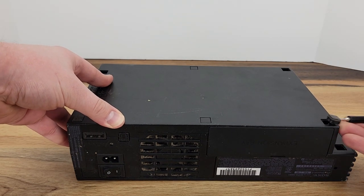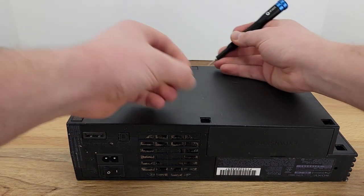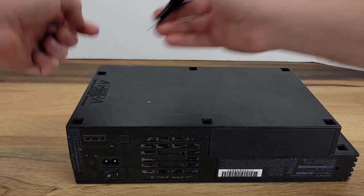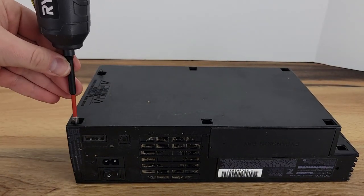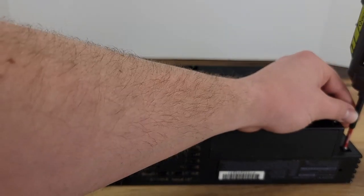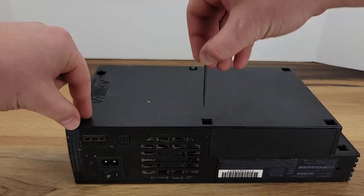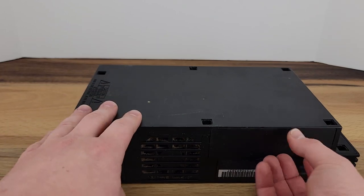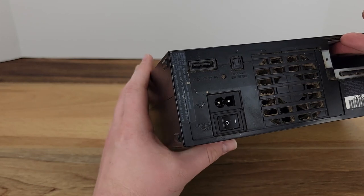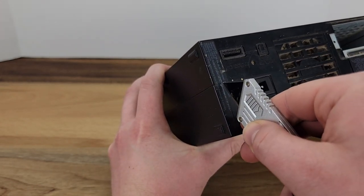The rest of these, you can use a small flathead screwdriver and gently pry them out. We can now go ahead and remove the 8 Phillips head screws, noting the 4 long and 4 short and where in the console they're removed from. We'll also pop out the expansion port door as well. This console is already beat up and scratched, so I'm just going to use a razor and quickly cut the warranty label.